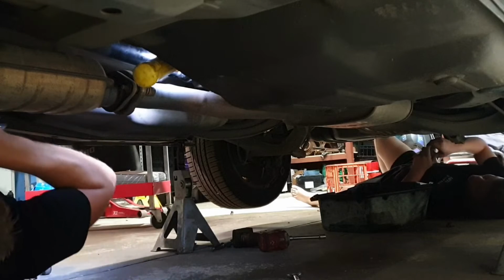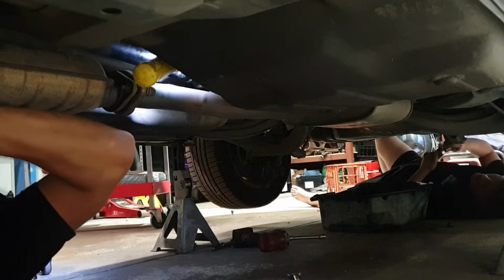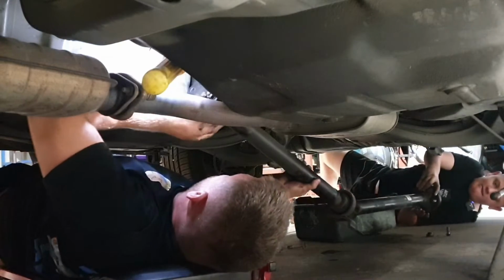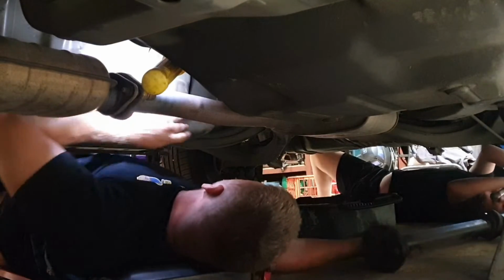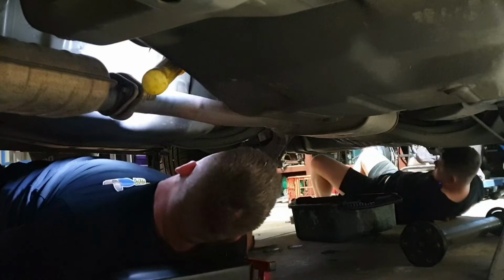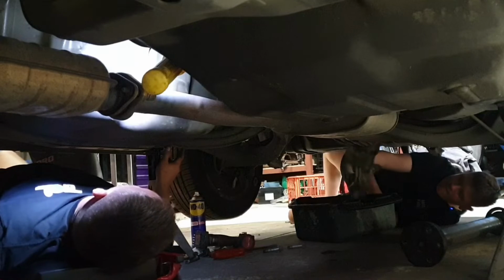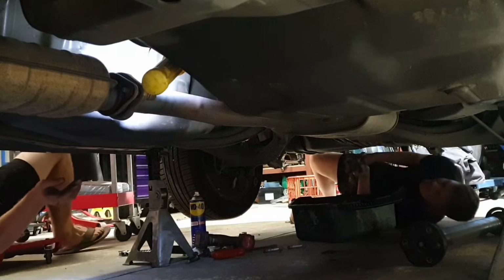Did you take the drain plug out yet? No, not yet. Seem to have got it. You grab that into the shaft, mate. Oh, hold on, there we go. Righto, you got it. Right, well, it looks like the diff oil's drained. You give that a wipe, put the plug back in. I'll actually put some thread sealant on that one. We'll throw that back in and then you can work on your tricep pumps, eh? Pumping that oil back in.